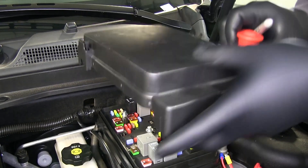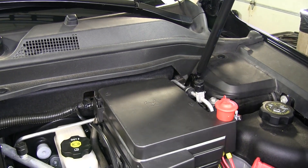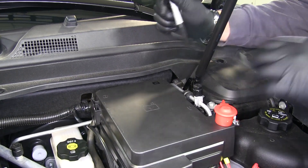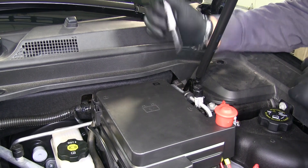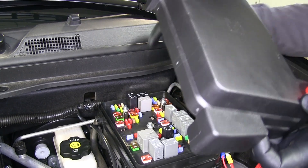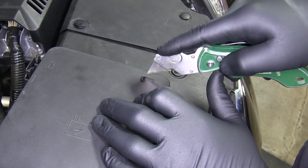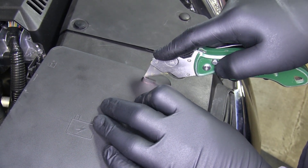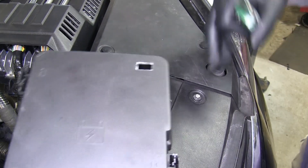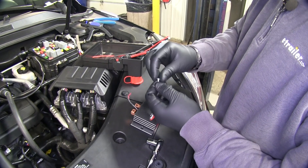Next, where we took our fuse out, we want to set our cover back in place and mark where our fuse is. We're going to take a knife and cut that out. We're going to be feeding two wires through there and connecting them to those two posts. I'm just going to use a razor knife and score right along the outside edge where we marked it. You're going to need your fuse block, a 3/8 socket, and a Phillips screwdriver.